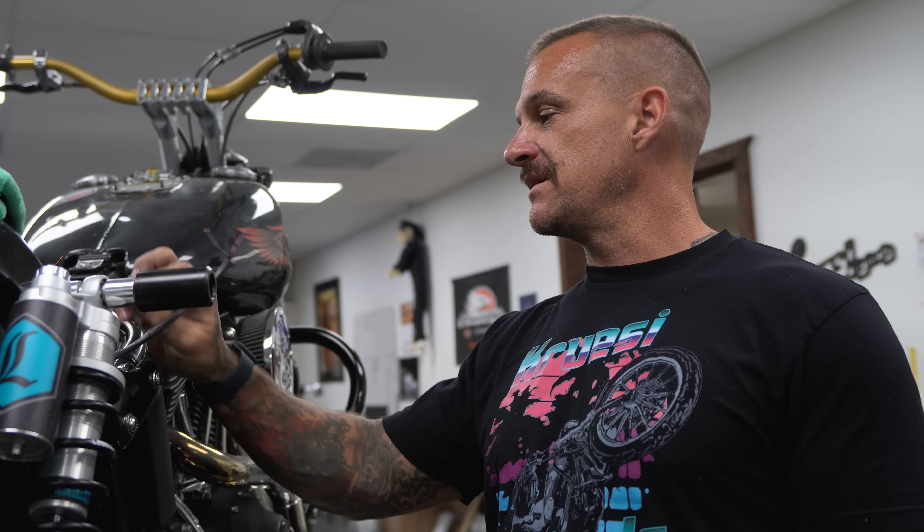Here's where we're at: I got the brakes on, the brakes are bled up — best brakes I've had on this thing since day one. I think this master cylinder honestly just needed to be rebuilt right out of the box. Sometimes they've been sitting on a shelf too long and the internals wither up. I'm now going to wire up the brake tail light, which I haven't had brake lights on this thing either. I need to put a load equalizer in there because the light doesn't have a two-wire switch — I've got to remedy that situation.